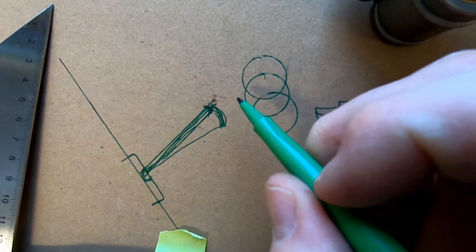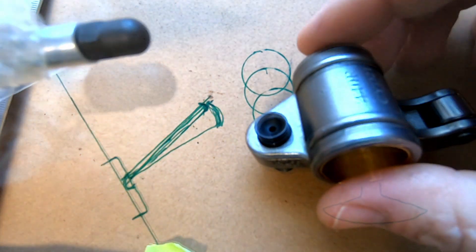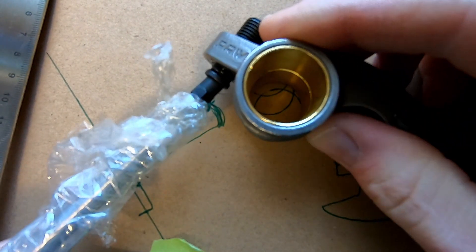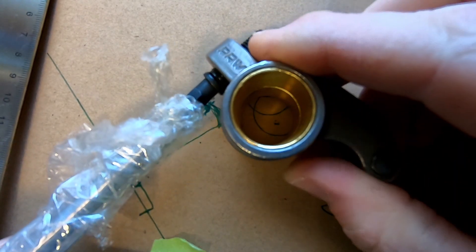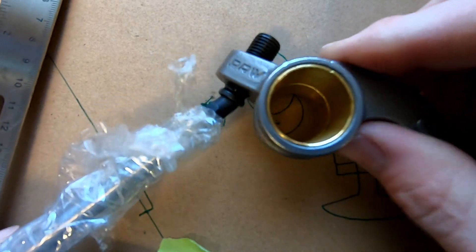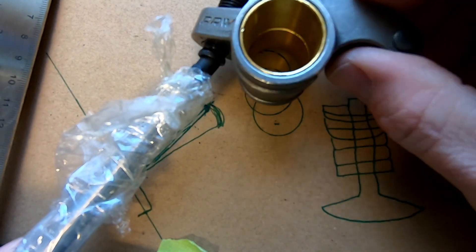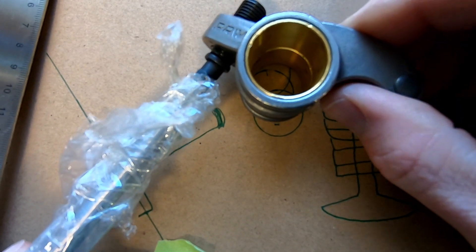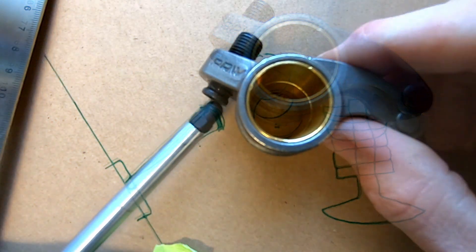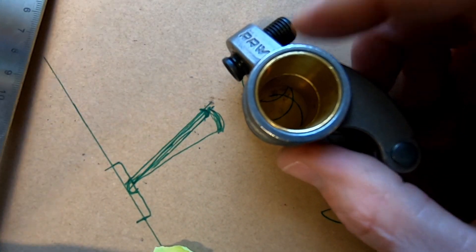I like this idea, and here's why. Here is the ball adjuster and the ball into the push rod. What it does during its travel with that wide sweep — it has to work just like this, so the whole push rod itself has to wiggle and move with it. Every time that happens, it just grinds the end of the push rod, shoving it back and forth into the tip of that adjuster forever. But if we move it with the upward motion and the limited sweep, it has very little sweep. It will change the geometry of your rocker system and cause less wear on the tips of your push rods and your adjusters.